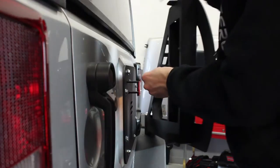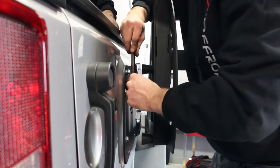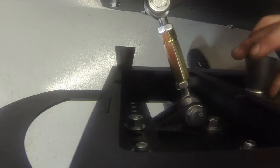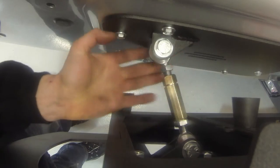Set your link and tighten the top bolt first, then tighten the side bolts. Lengthen the tailgate link and then close the gate and install the half-inch by two-inch bolt — you may need a punch to line everything up. Tighten the link until the rubber isolators touch the tailgate plate. The rubber isolators may need to be shimmed out with washers, depending on how the bumper is positioned.